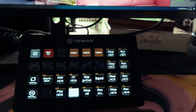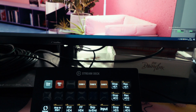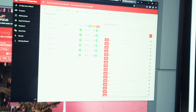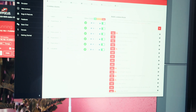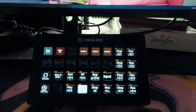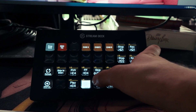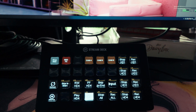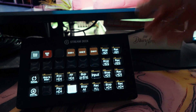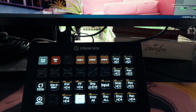Additional control is done via this Stream Deck down here. We switched from controlling Ximetry directly to an app called Bitfocus Companion, which runs on the local machine and is controlled via a browser. This lets us control devices on the network — the four HyperDecks, the Video Hub router, and the audio mixer. We can hit record on any one of the decks or all at the same time, switch inputs, and do playback. Timecode is injected onto the recordings to ensure sync across all decks, which is important for multicam recording.